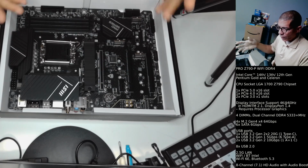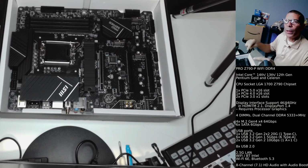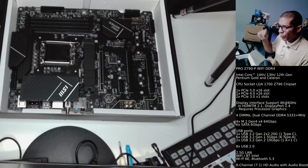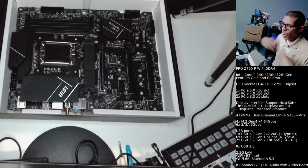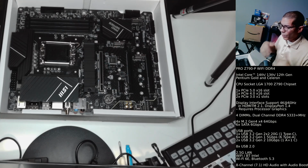that you're going to be handling, just like we're about to do, as well as the installation, you have to make sure that you don't touch any of the bare metal pieces, just to prevent discharging any static electricity that you have accumulated by moving about. Obviously, there are certain conditions that you have to meet for your body to accumulate static electricity. Your clothes, what kind of flooring you have, especially carpet and stuff like that, or a plastic mat, not rubber, plastic, tends to, via friction, charge up with static electricity.